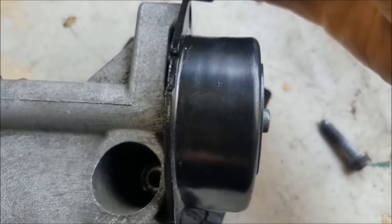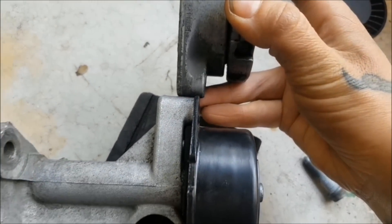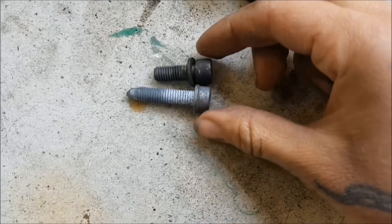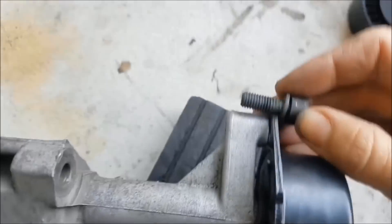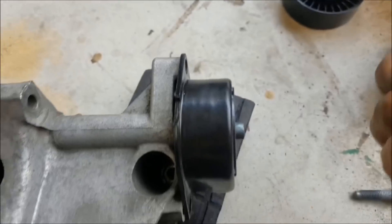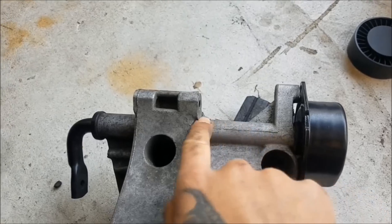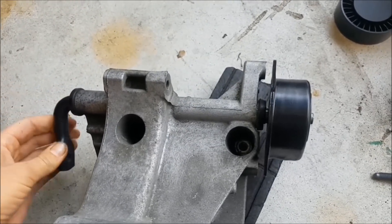One thing I did notice was the thickness difference between the old tensioner and the new tensioner, so these bolts aren't going to fit. I just had to find bolts — I have a whole stash of Volkswagen hardware — but I had to find some that were a little bit shorter. I just sort of measure them, making sure this one goes all the way through, just to make sure the tensioner assembly would work. Whenever you pull this out, make sure you lubricate the shaft inside of there so that everything moves nice and smoothly.